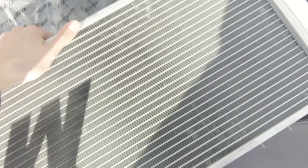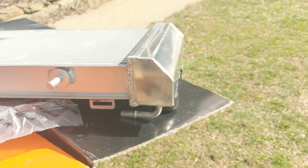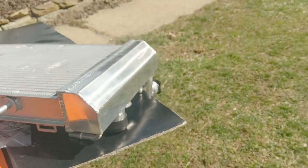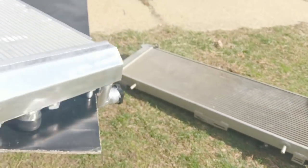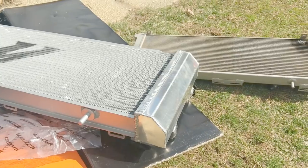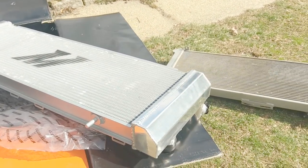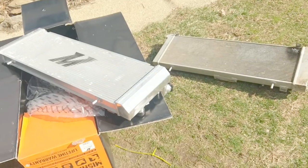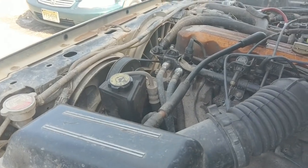This is one of the few that actually has the logo painted on there — you see it on images all the time and this one actually has it. Neat. There's the side tank design — a lot bigger, thicker. If we compare it to the old one, it's really just kind of square. I wonder if the bigger side tanks help. They claim something like 90% better cooling capacity compared to the stock one — yeah, these aluminum ones are killer. Not bad. For the price, it looks good. So as long as we can figure out how to jerry-rig up that upper trans-line hose, she should swap right in.